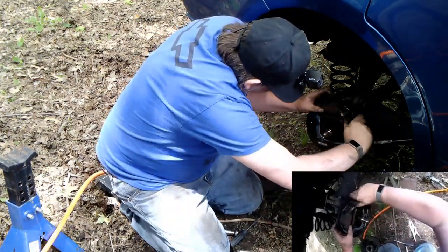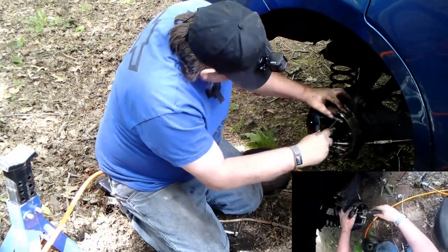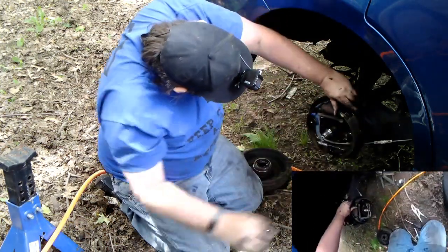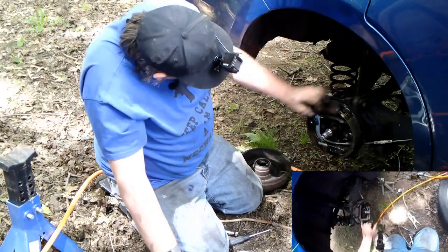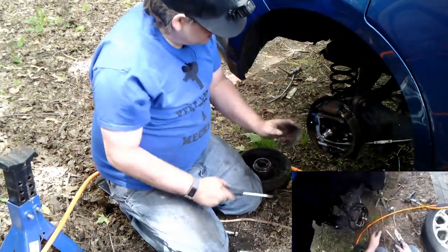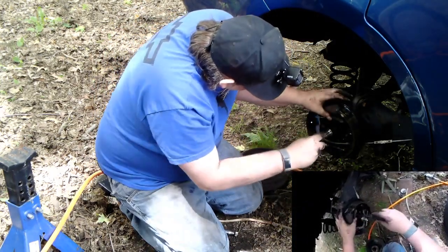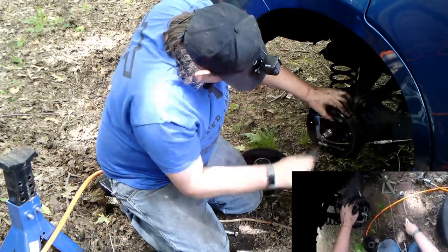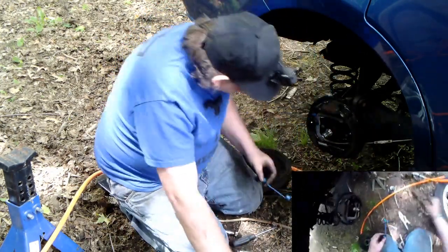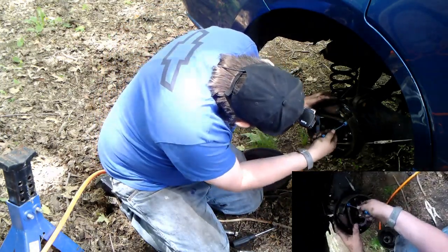See, when I pull on it, it should ratchet out. That's how that self-adjuster works. When you step on the brakes, the service brakes, the hydraulic cylinders push out, and if there's room to click, it clicks, and then it holds it out there. So next time you step on the brakes, the pedal doesn't have to go down so far. So that's how these self-adjusters work. They're very reliable self-adjusters, much more reliable than the star wheel style. It's just they're finicky, that's all. That's exactly right.